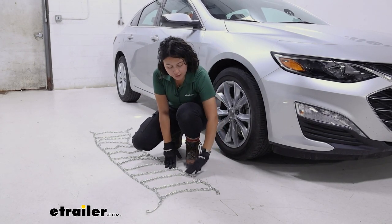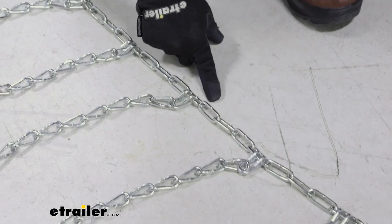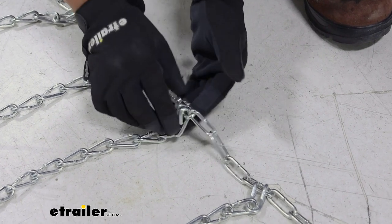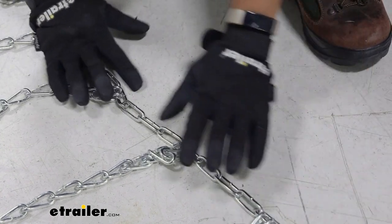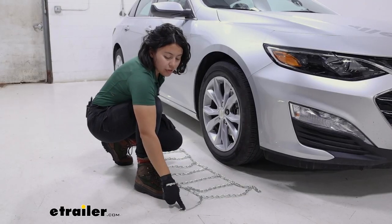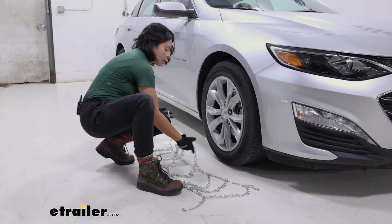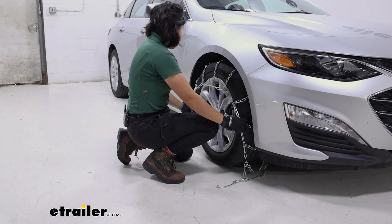We're going to look at how to make sure the chain is tangle-free and facing the right way. See how the ends of the chains are all facing the right way and not malformed. You're also going to make sure that the hook is facing away from your tire and the flat part is facing the tire. I have the flat part facing down and just comb out the chains. The longer tensioning hook should face the front of your chains and tire as you drape everything over — grab them by the middle and gently place them over the tire, making sure there's an equal length on each side.